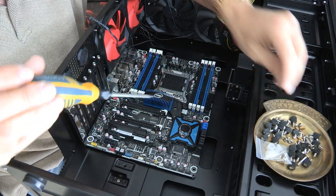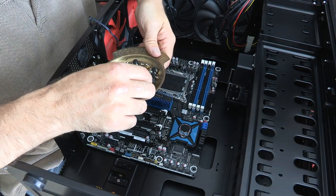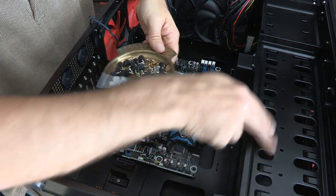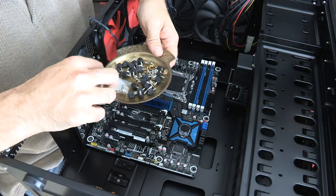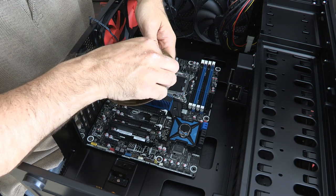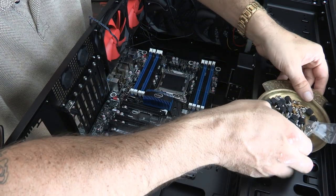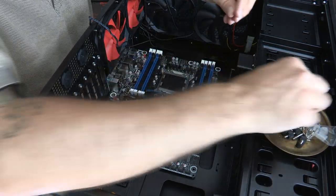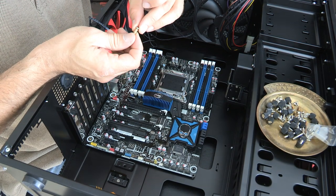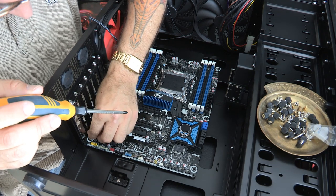It's going to be a smaller thread — those are a larger thread. I've got an awful lot of thumb screws, which I believe are probably for the hard drives and everything. This is for the 2.5 inch drive. I've got these — they're a smaller thread. There were no screws that came with the motherboard. I'm going to try this on one of these and see. This one fits in perfect. I'm going to guess that is what goes in here.